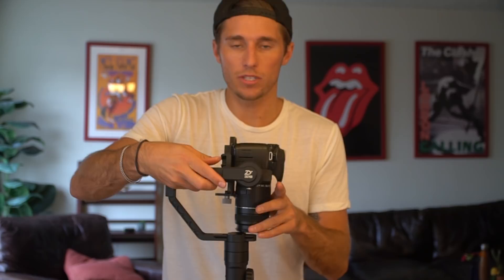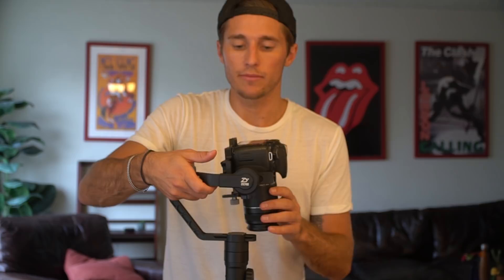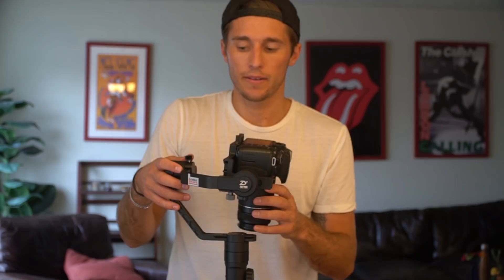You always make micro adjustments — the smallest movement on these gimbals has a big effect, so you only need to move it just barely. Every time I move it, I'm just letting go to see if it's falling back. That is perfectly balanced for this motor, so now I'm going to tighten this. And now we're going to move on to the back motor.